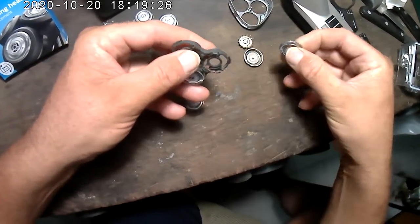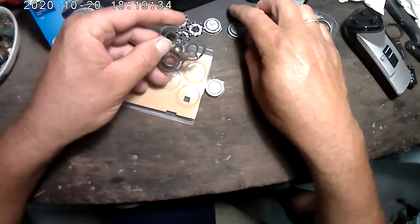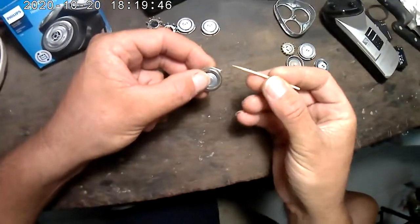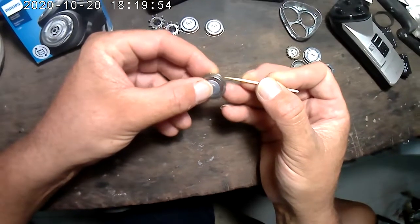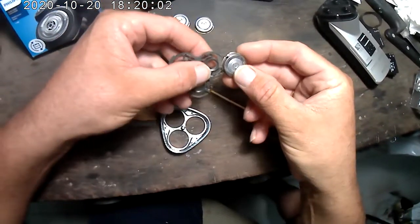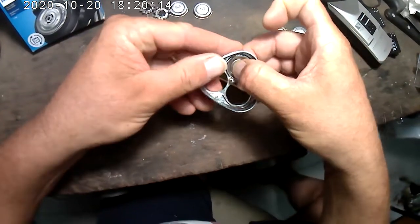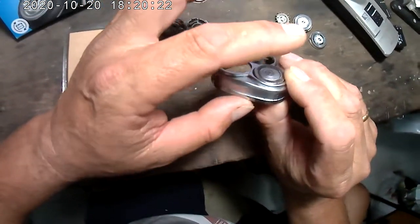Okay, so let's take these off so I can show you why the new ones, which are these, won't fit. On these I've already ground off the tab. This little tab here is what has one here, and it had one here, but I already ground that off. What happens is that the tabs rest on the outside. So this is the position, and as you can see, the tab hits the housing